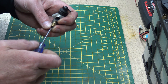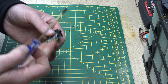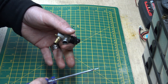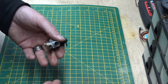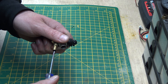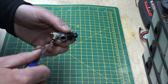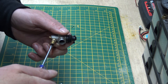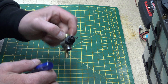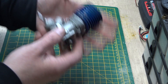That's it, done, sorted. People who know what they're talking about are probably going to say I didn't say to check where your settings are before you took the needle out. Now, before you take the needle out, it's a good idea - if your engine was a good running engine - to turn the needle in gently until it stops, then count how many turns in it is. That's how many turns out you need to do to get back to exactly the same place, so the engine will run exactly as it was before. Do the same for the low-speed needle.